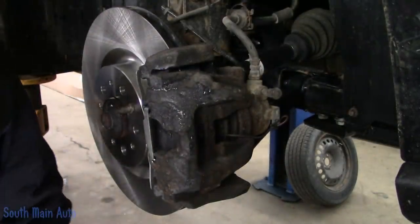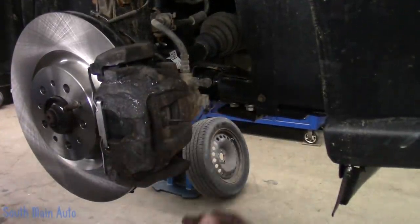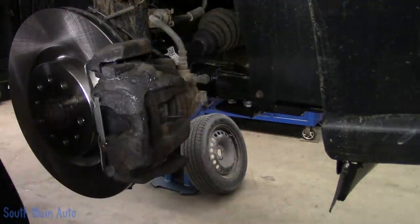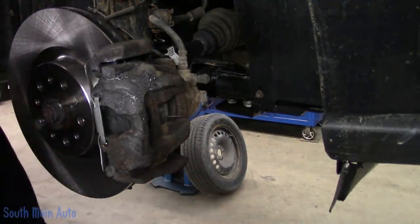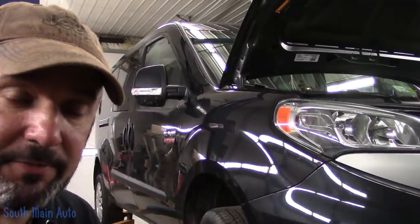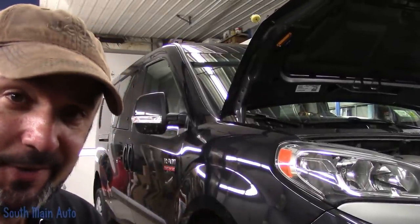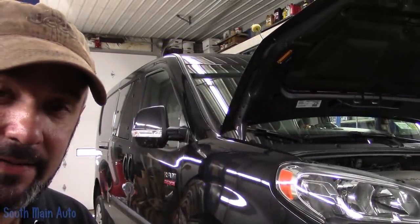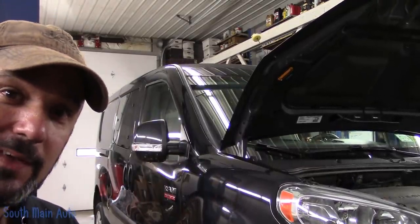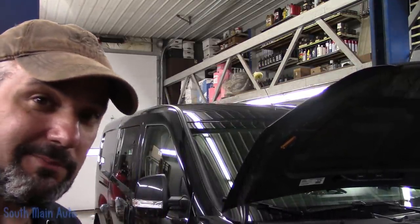Put your wheel on, pump up your brakes, fill up your brake fluid if it's not already, and take it for a shake — but don't do that until you finish the job. Got the little black caps. There you have it folks: front pads and rotors on your 2016 Ram Tough ProMaster City. Pretty easy job. Make sure you pump up them brakes though so you don't send yourself for a little panic ride — you'll know what I mean if you've done it. Go down there in the comment box and leave your questions, comments, criticisms, concerns. While you're down there, subscribe. And just remember viewers: I can do it, you can do it. Thanks for watching.